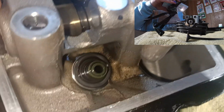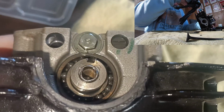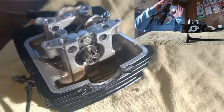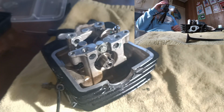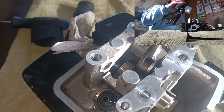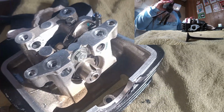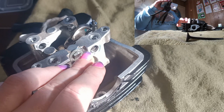Now, something that I didn't show previously was that I have damaged the camshaft a little bit. If I can't get this running now, I'm going to go ahead and replace this whole shebang. Which means the only thing that doesn't come with the replacement head, it comes with these valve seals already in place. All the rocker gear and the camshaft I would need to transfer over, but I would probably buy a new one just to cover my odds with that damaged thread.